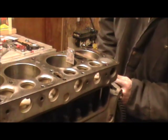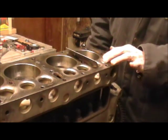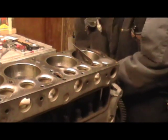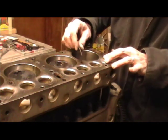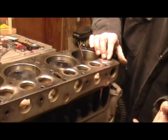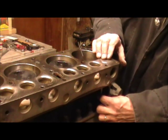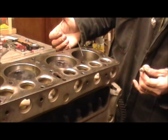I'm going to move the engine a little bit to get the cylinder moving down, and then we're going to test the valve. If the valve starts to open, we'll be able to twist it. We don't have any spring on it right now — we're just trying to set the height. Right there we're still not all the way down, and our valve is already starting to open. That means the valve stem is too long. I'm going to grind about ten thousandths off the very end of the valve and then test it again.